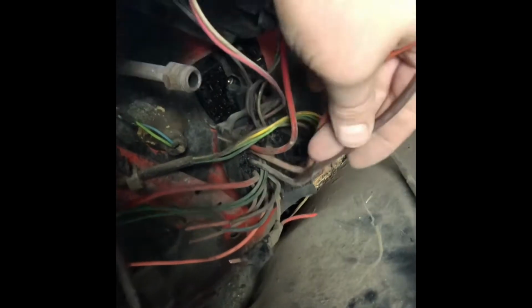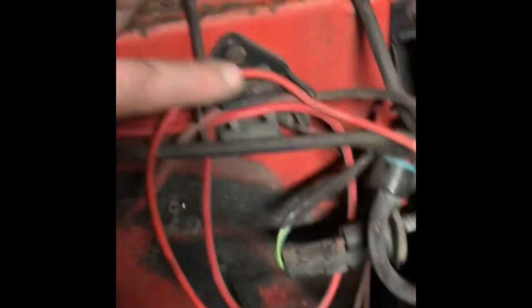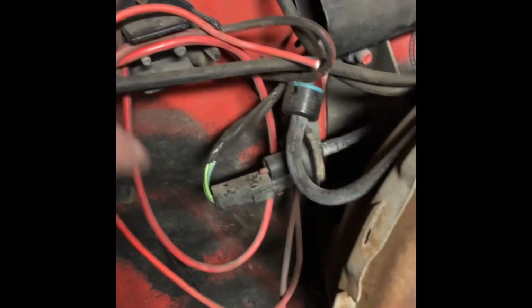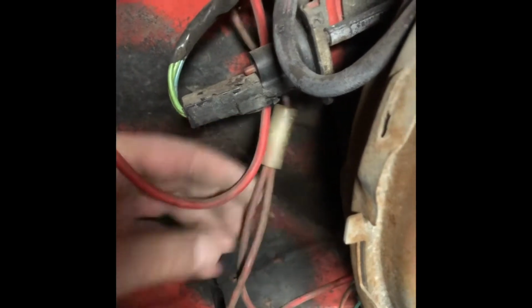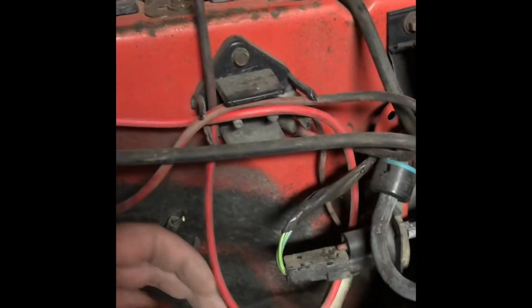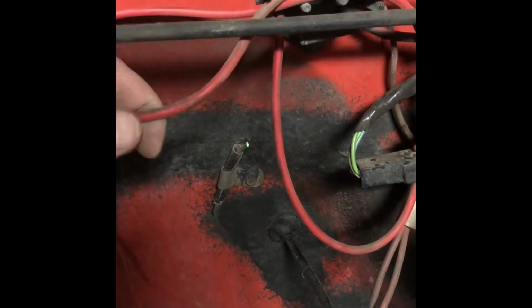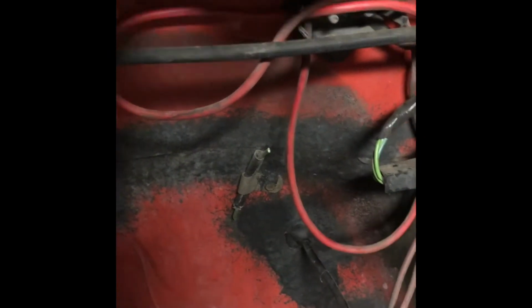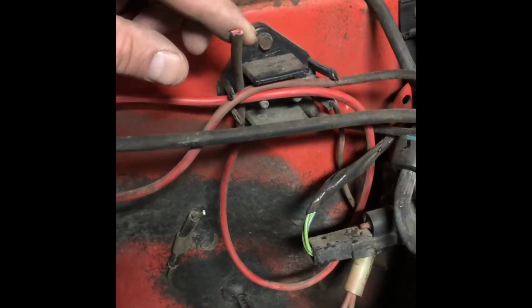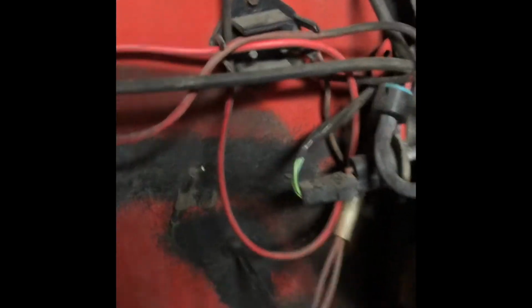This purple wire, that is for the starter. Wire down here, it goes up to this fuse block up here. So you can see I just snipped and cut it. Has a fusible link in it. That's where the alternator would have come in at. And then this would have gone over to another power source, I believe. But the LS forums and everyone says save it for your HVAC stuff going on there. So yeah, it's saved for right now.